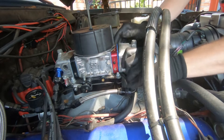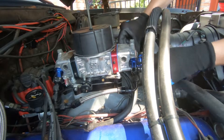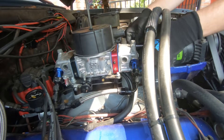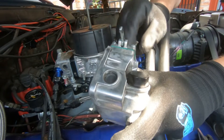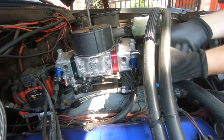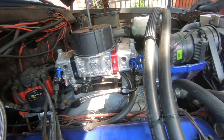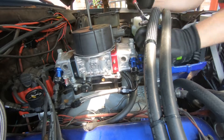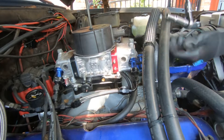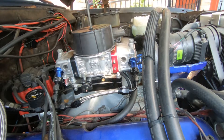At this point it's just a matter of reinstalling the metering block and repositioning the bowl of the carburetor, then putting the four bolts through the bowl and the metering block to reinstall both of them. After that I'm going to close all of the idle air screws completely, back them out half a turn, and start the truck. Then I'm going to use the air fuel ratio gauge in the cab and reference between the AFR gauge and the vacuum gauge to find the best idle position for the four-corner idle air control screws.